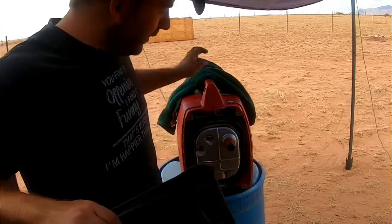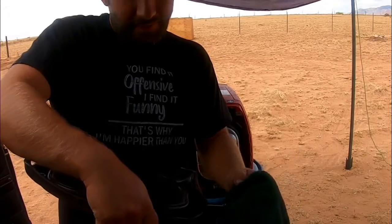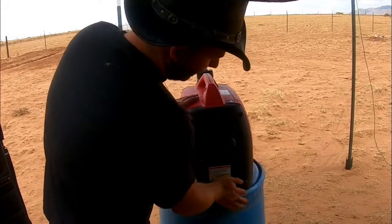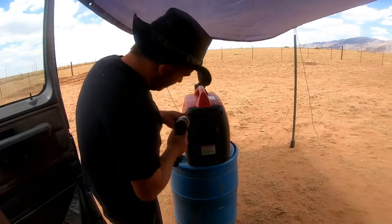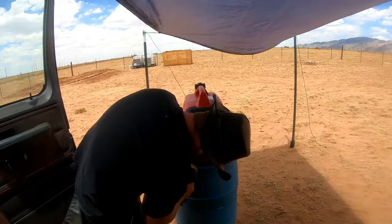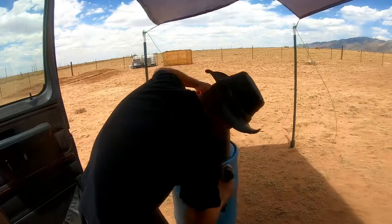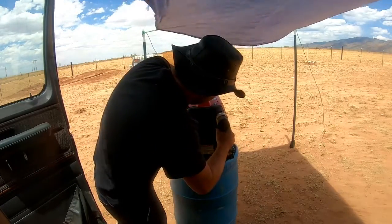And look at that, I see me a little bit of oil. So one thing I don't like about changing oil on this thing is if a little bit of it runs out, you'll find it later on. It'll gather in places like that. Okay. We'll put it on. Just make sure that rubber gasket seats up right there on the body of the generator. And again, we'll just snug these down. Okay. We'll do 1, 2, 3, 4.